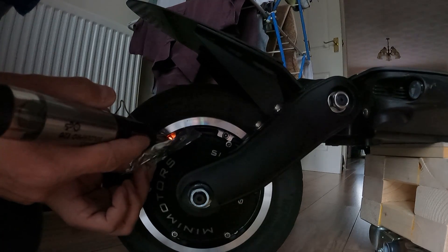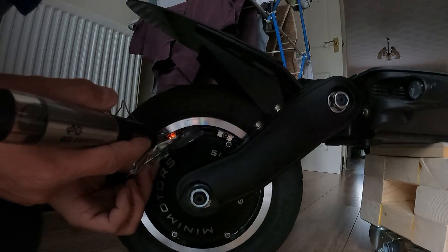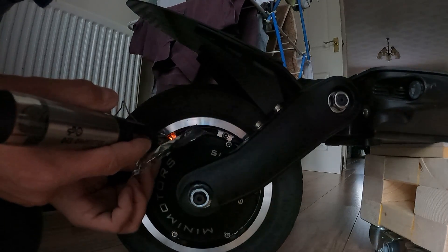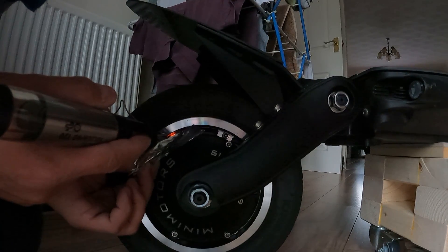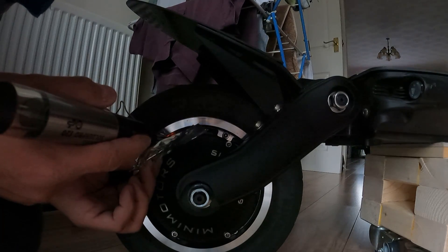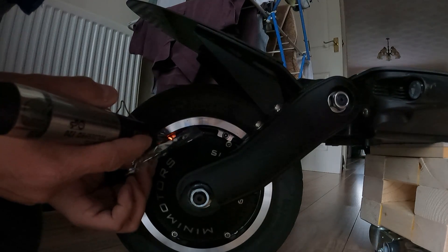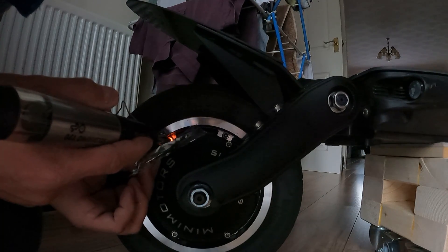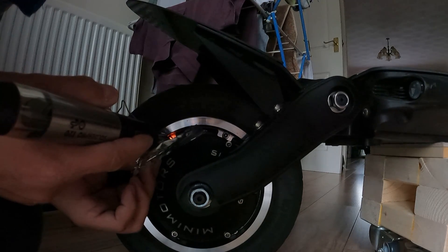Just keep this going for about a minute or two. I see on forums some people say heat from the opposite end on the aluminium — I don't really recommend that because the heat will definitely transfer onto the motor. But doing it this way, after a couple of minutes, the aluminium around the bolt will still stay cool, but the bolt itself will be piping hot.